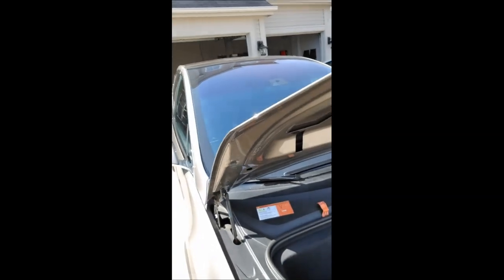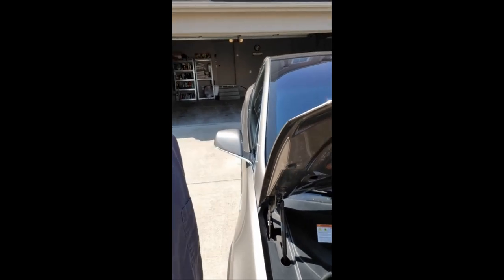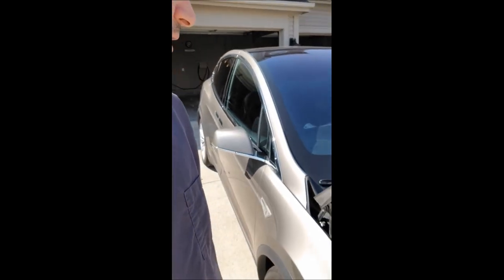The previous Model S, before the facelift, used to be lucky enough that underneath the hood, all you had to do was look in this spot right here, take off this panel, and you've got the cabin air filter. For those of us that have the newer models, they thought they'd just make it more difficult, and from what I'm understanding, it's because the HEPA air filter is now located down in this area, and they had to redesign the whole intake from the way it sounds. So because of that, now it's located inside the car, and it is now behind the glove compartment.